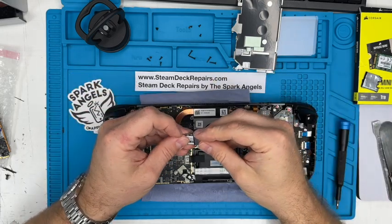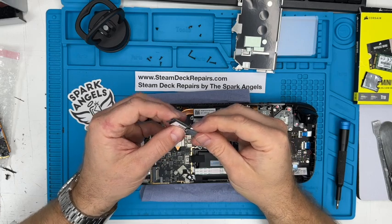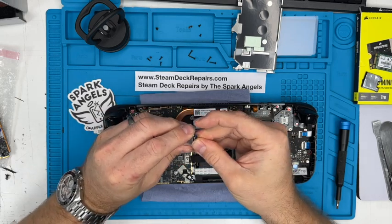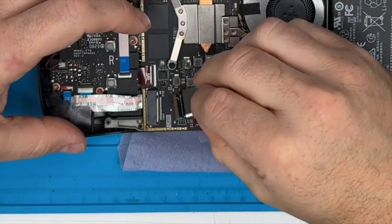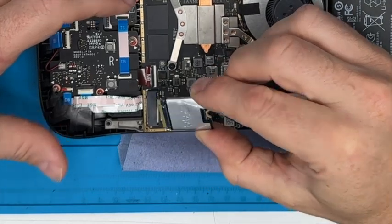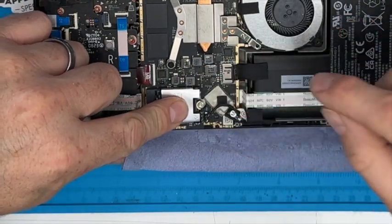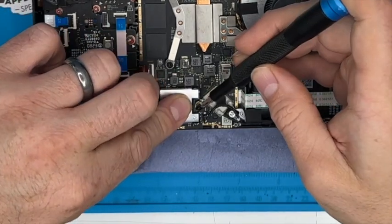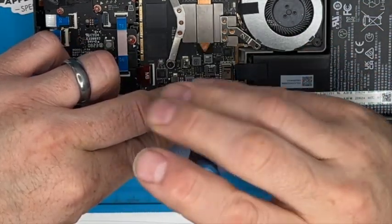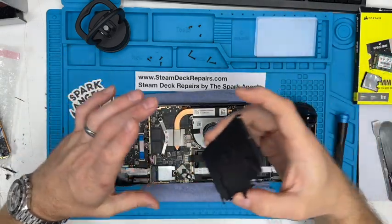If you need help, SteamDeckRepairs.com — we do all manner of SSD transplants for our customers, all the way up to 2 terabytes right now. There's a little chip just getting in the way; I need to get something slightly underneath that just to lift it over. We do spare parts, we do the repairs, we're UK-based but we do ship worldwide and take in repairs from worldwide as well. Once you've got the SSD in place, slide it in at the same sort of angle — you don't want to go in flat, you want about a 30 degree angle. Slot it in, find its way home, and just pop it down. Get that large-headed screw again — it should drop in there nicely — and it holds it in place. We've not disturbed anything else, so that's pretty cool.